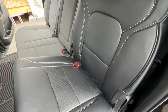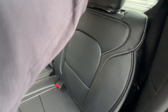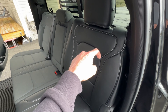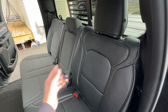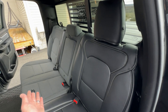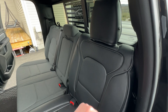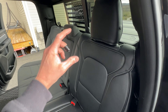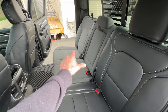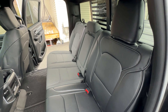To shut it, you lift the bottom seat up so far that the back seat pushes in, then push your bottom seat back down and you're locked in — good to go. Just be careful doing this because if you cut that bracket too short, it won't lock. Pay attention to the other seat before you cut — mark that bracket for how much you need to cut off. You just need to cut off enough so that when the seat is lifted up, the seat bracket on the back is just above that black bracket, but there's still enough length left so when you push the back seat back and drop your seat down, it'll drop down and latch in.